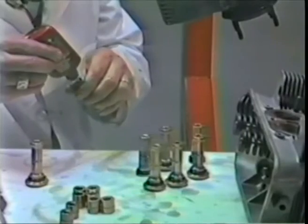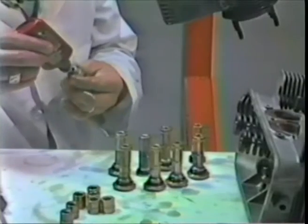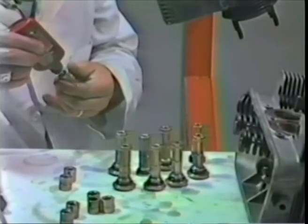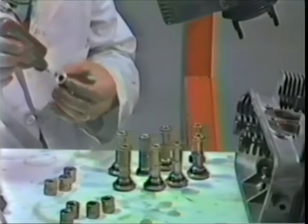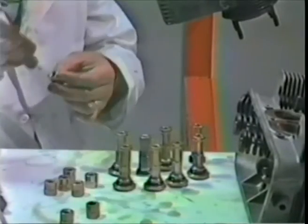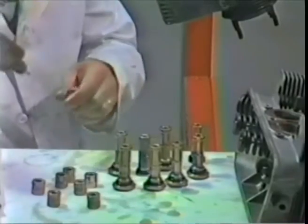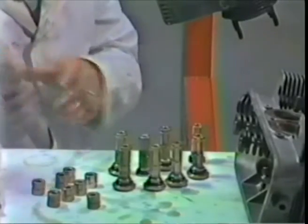The blue Loctite allows for good torque readings and will maintain everything fairly snugly, but can be retorqued if you have to, and can be broken loose when you want to get the head back off without having the studs come out. If the stud does come out, all you have to do is, once you get the nut off of it, take 2 17mm across the flat nuts, kind of the ones that hold your 4 studs in the engine to the transaxle, and double nut them against the stud, put a little red Loctite on the stud where it goes in the case, and then tighten the stud back into the case. Of course, buy a stud removal tool, which is a very nice, cam-activated device. Snap-on has them, I think, for about $15 or so, that allow you to remove studs very nicely.